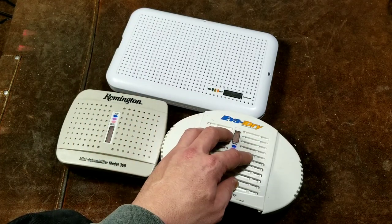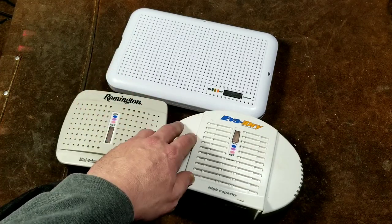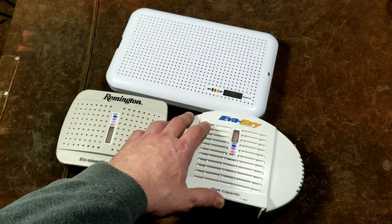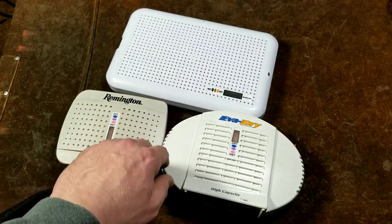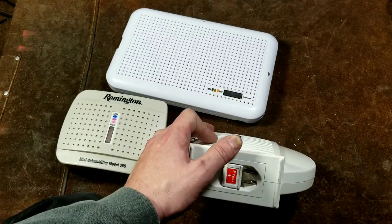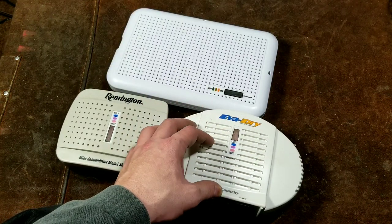One thing of note is they won't absorb water when they're too hot. That's one caveat: they won't work while they're plugged in. They have to be dried out, then unplugged, and then allowed to cool off before they really become effective. They all work pretty well — it's just that some are much larger sizes with much more powerful heaters, so they dry themselves out more quickly. Some have power cords you have to plug in with and some have integrated plugs. One disadvantage to integrated plugs is that over time the little contacts can kind of wear and give you some problems. I've always liked the more traditional cord-and-plug model because it's a bit more reliable over the long term.